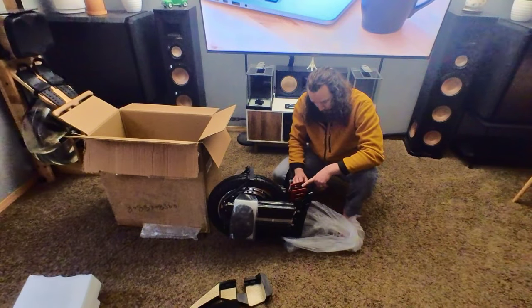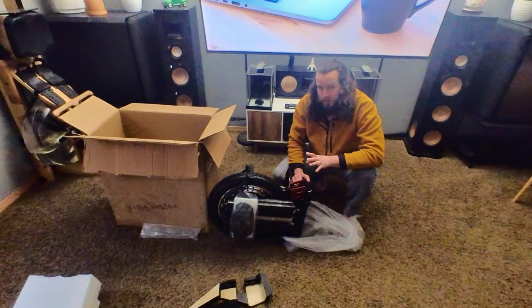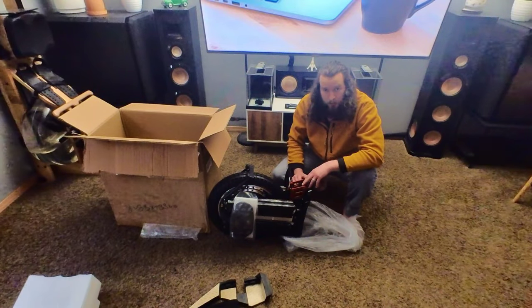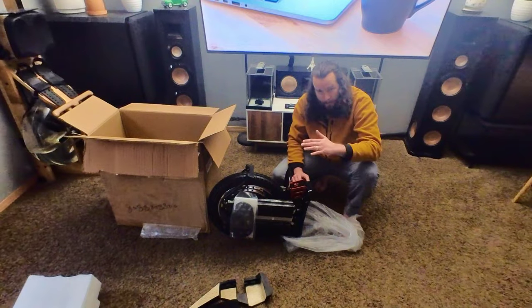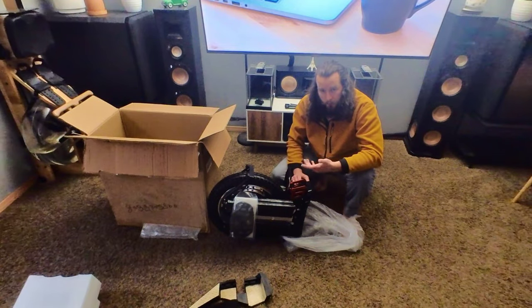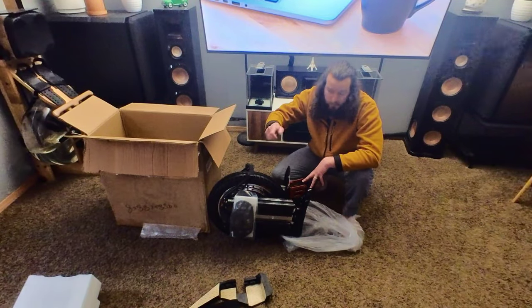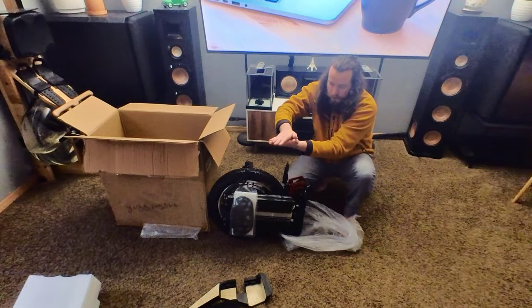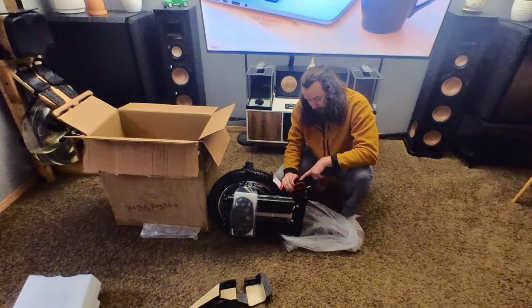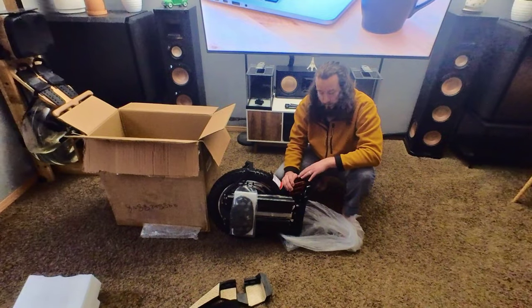The air suspension on this one does have dampening — that's a huge plus for me, as wheels feel very bouncy without it. Actually, to clarify: what these knobs control is rebound, not dampening. Dampening controls the suspension travel downward; rebound controls how it returns. You can see in one of their videos testing on the EX20S where they turned the rebound all the way to slow — the gentleman bounced on it, the wheel sank and didn't return, then he turns the knob and the wheel pops back up. That is rebound. Dampening on an air shock is how much air you put in.